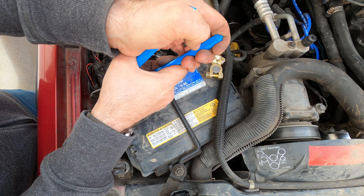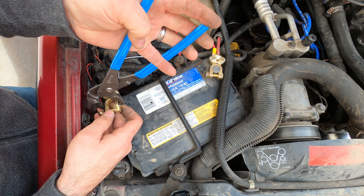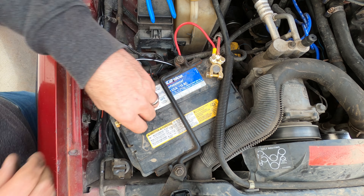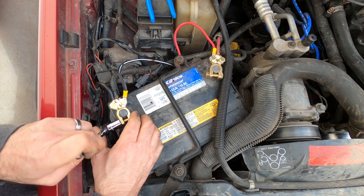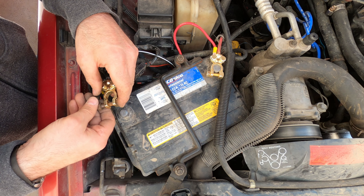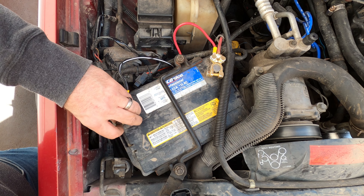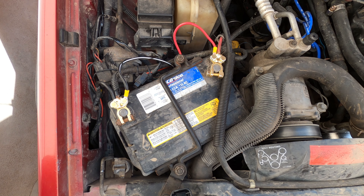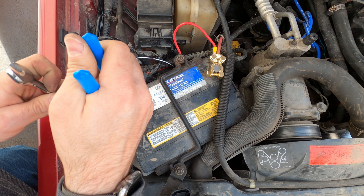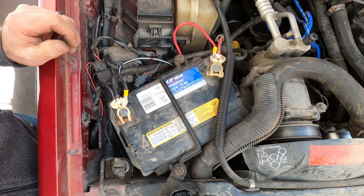After starting it I thought maybe I should use some pliers and try to squeeze it at the battery terminal — do a little bit of the opposite of what I did on the other side and see if I can get it a little closer, because that would definitely be a better short-term solution. That already feels a lot snugger. Hopefully I didn't damage the threads on the bolt too much when I was torquing it earlier. Seems like I did — I ended up damaging the threads because I was torquing it way too hard, and then I lost the nut under the battery. Instead of fighting with it, I'm going to use the bolts off the old terminal and see if this can be tightened correctly without any play. Oh, that's great — doesn't move at all. Consider this a success. I'll start the vehicle another time just to make sure. Thanks for watching.